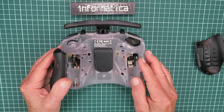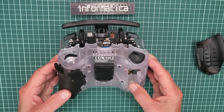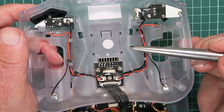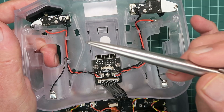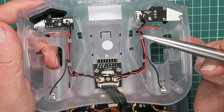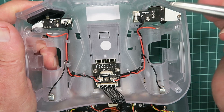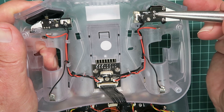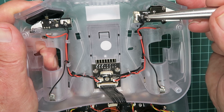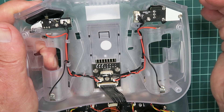Clearly there will be some wires inside, so we have to go carefully as we remove this. Here we see inside the unit — on the left-hand side we have the momentary switch. But what we're interested in is the potentiometer connection. We have the rotary pot there, and a three-way connector handily labelled for us as 3.3 volts, S1 — which is obviously the signal input — and negative going to the pot.